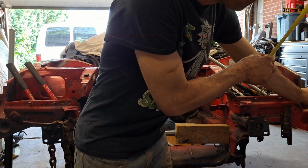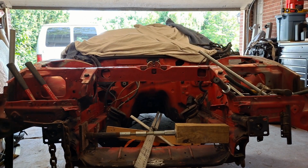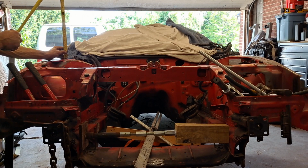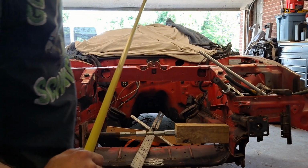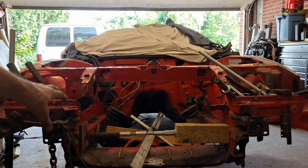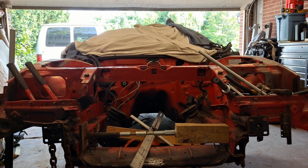Go here, we're at 17 5/8. Go to here, and we are 17 5/8. So everything is lining up, and obviously this has been leveled. We got 3 3/4 here at that little high ridge. 3 3/4 here at that high ridge. So everything is really good. The brace too was there to kind of keep that from moving as I was messing with this side. I think we're in great shape.